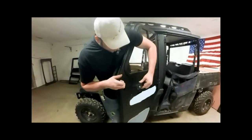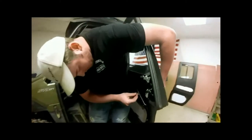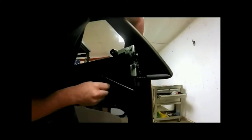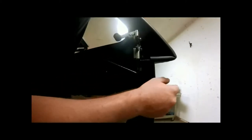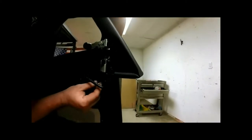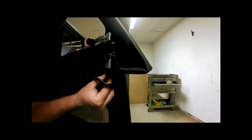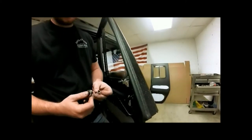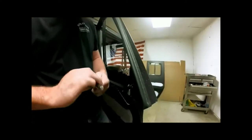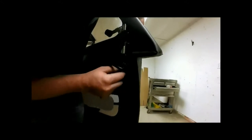Now to install our door handle, we'll put our punch in this big hole here, and we'll open it up. We'll come through our channel here and go ahead and get our bolts all started. Come to our front 2 here. This is where your 10mm socket comes into play. And we'll go ahead and tighten everything down.